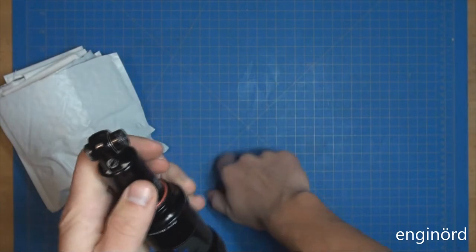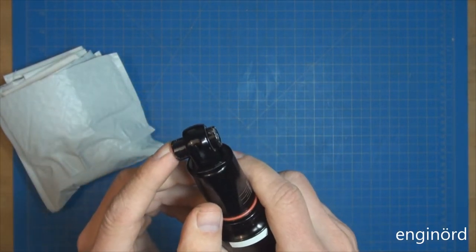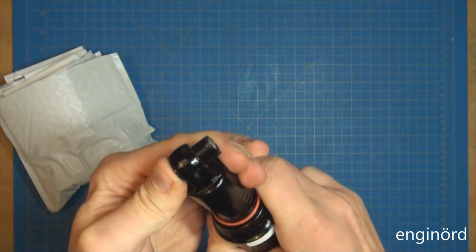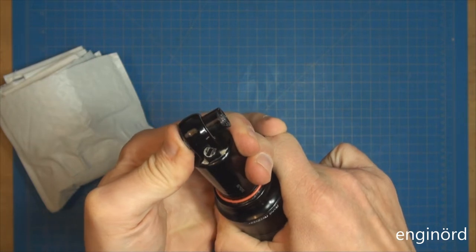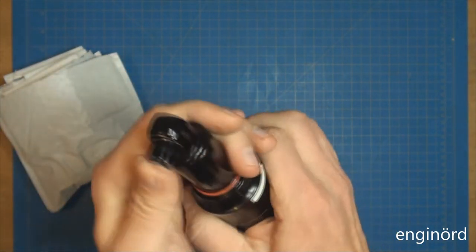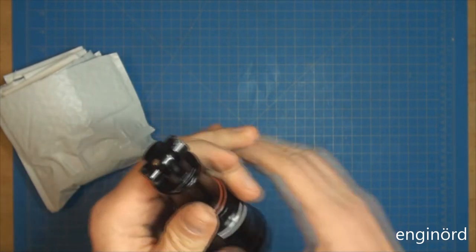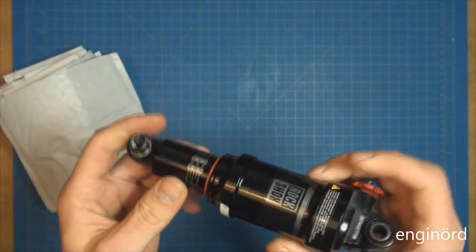So the way this should work is, when this pin or shaft is installed, I'm pushing with all my might and it barely moves. You can see how hard it is. Look at that, you can see how much force it required to move this shaft in the bushing. That should be the normal. So if you wiggle it and it moves, that's no good.